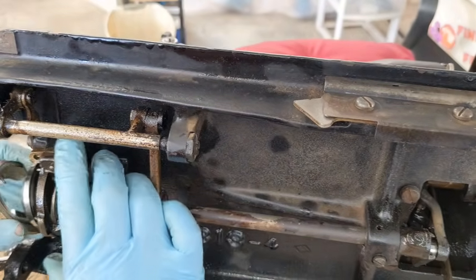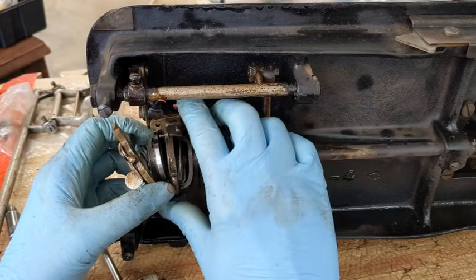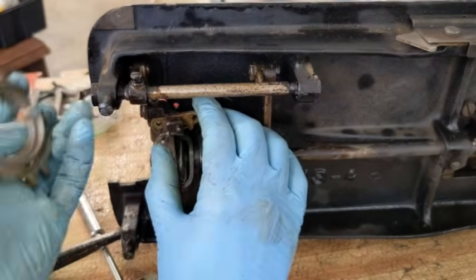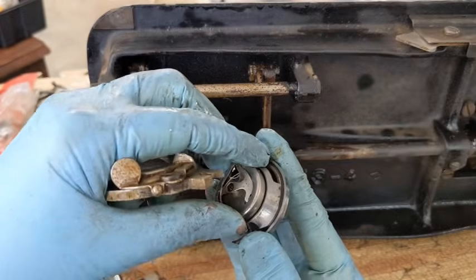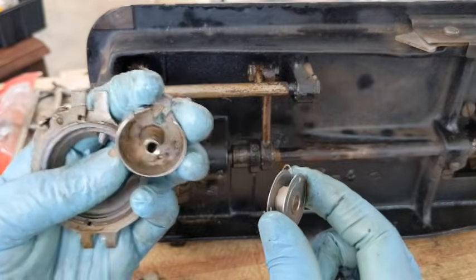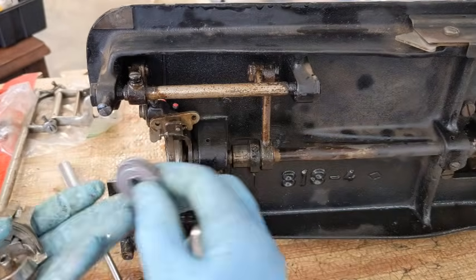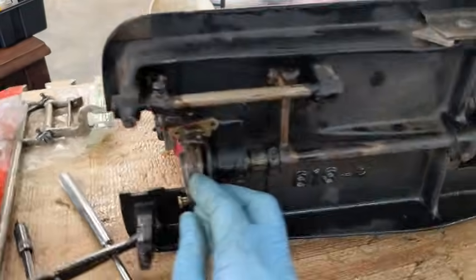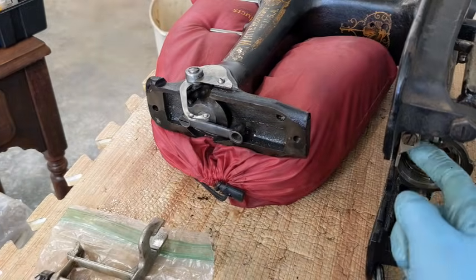I might go ahead and pull, hang on, that went very fast. This little spring-loaded clamp here, if you push it down, like I just did, this front piece is going to come off. The bobbin case right here. There's a bobbin in it. Lovely, special bobbin. The bobbin case is going to come out, and the little hook. All of these are going to go in and get started getting cleaned. This does not look rusted in here, which is very good to me.